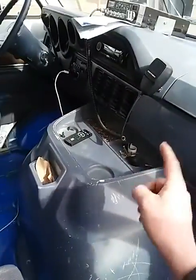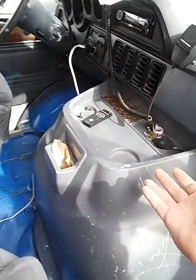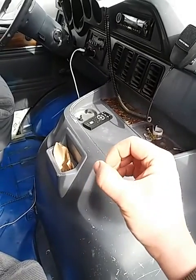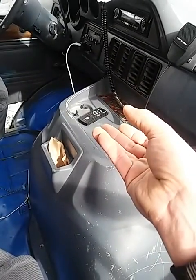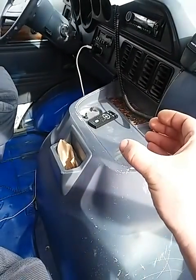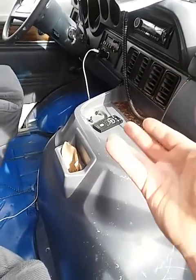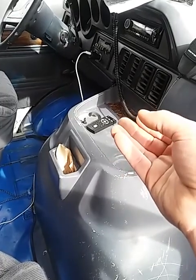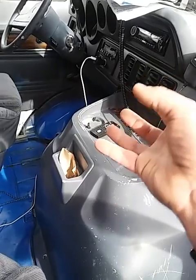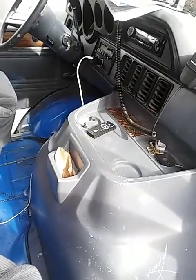But thank God I actually replaced the temperature sensor, because if I wouldn't have done the temperature sensor, I would not have known what was going on with my vehicle. Turns out the thermostat that I put in there had a circle brass cup on it, and that cup actually swelled to the full size of the inlet for the plenum. And so that caused it not to open, even though it was a 160 degree thermostat. It should have opened well before the actual H on the hot scale on my temperature gauge up there. But that didn't work.